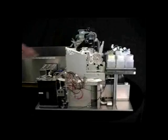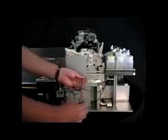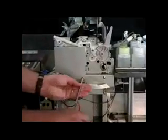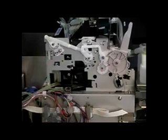To gain access for the plumbing underneath the area — that's everything under the printhead, the capping station — we need to remove this ink splash guard. There are two screws, one here and the other one under these wires, so be careful not to pinch or crimp any wires. Then remove the splash panel.